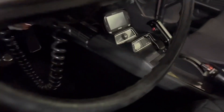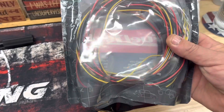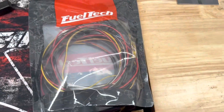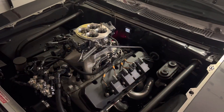I've got a four-foot harness — I hope it fits. I think it's going to reach from the back of the FuelTech down there back into position. It's CAN bus and I'm not using it for the O2, so really all I need is power, ground, and CAN bus. The rest of this harness I'm just going to cut off. I know it seems kind of painful to do because this harness does so much, but I don't need it — and it's just money. Let's get this thing mounted and plugged in and see what it does.